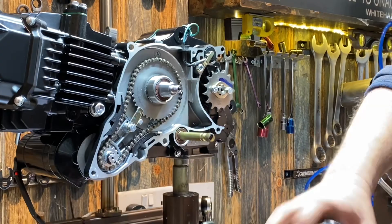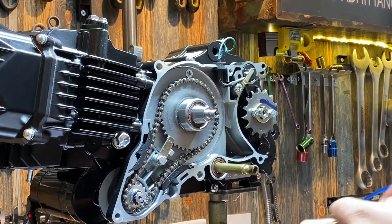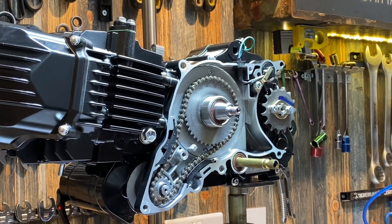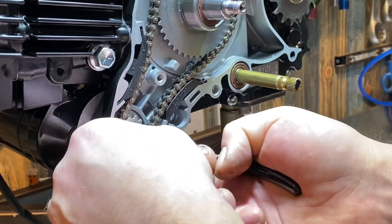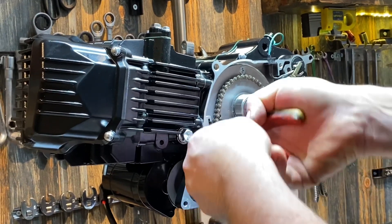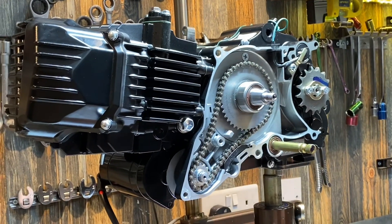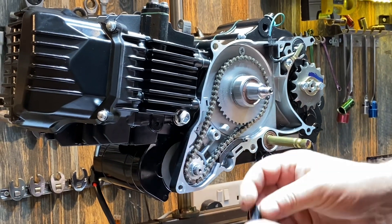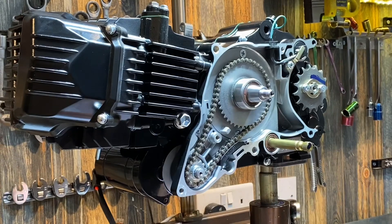Put the flywheel to one side. Undo the 10mm retainer and put that down. Next, remove the circlip off the end of the starter drive. Take the top rubber out — you can leave the bottom one in, we don't need to disturb that. Give it a little pull, drop the chain over the centre run and then a second pull and it's out. Keep it in the same rotation you take it out so you know how it goes back in, as it is actually handed.